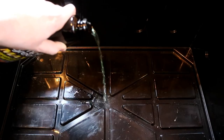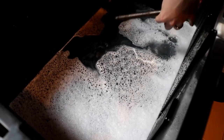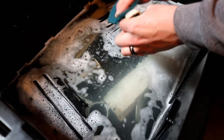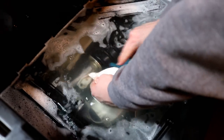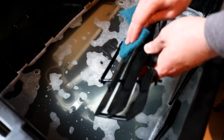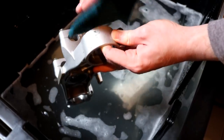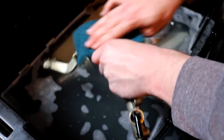For the rest of the smaller parts, I just made them a little bath with some Simple Green Max and a lot of hot water. I just laid all the parts in here and let them soak for a few hours and once they came out they were just really easy to scrub up and get really shiny and clean. This Simple Green cleaner works wonders on aluminum — it really brings back a shine to the metal.